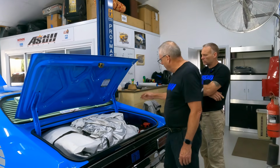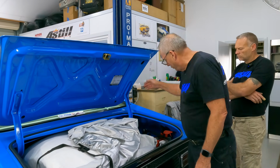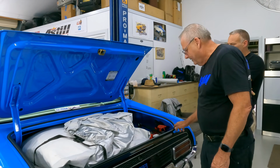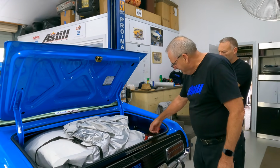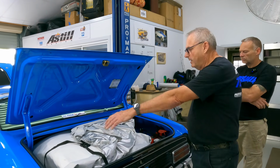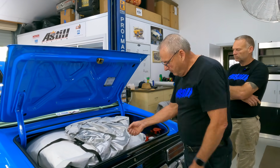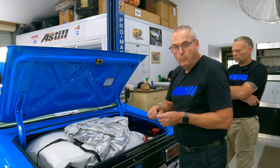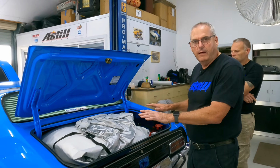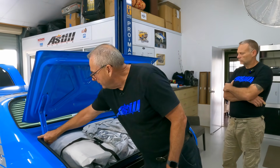And then people that know these sorts of cars, the boots tend not to shut real well. You can see that rubber, how tight that's been, and it's actually now matured, and the rubber's sitting down nice and flat, but here where it needs the extra gap, it's sitting up. And one of the little tricks we learnt doing these cars is, from the factory, there's little air holes in the back of the rubber. Because once you glue that rubber together and make it one piece, it's like a cushion. And if the air can't get out, then the rubber holds the boot lid up. So what we do is we get a sharp punch, like a hole punch, and go along and twist it and put a hole all the way around, so when the boot shuts, the air comes out and it takes the pillow effect away and just turns it into a rubber. Then over time it will settle so that it looks really good.